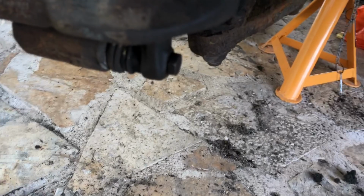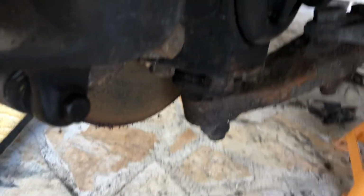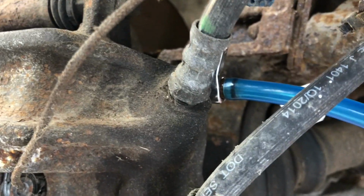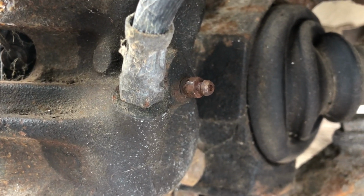So down here, the caliper retaining bolt, that one just there, is a 1/2 inch, and the bleed nipples, you can find one. There we go. That's a 5/16. Now the bottom one, a 5/16, has been rounded off. So the actual size ideally would be 9/32. Can't get a 9/32 spanner. Well, you probably can actually, but they're difficult. So I've managed to jiggle it and faff around, and we've got it to work with a 5/16. But you've got to be so gentle, because if you break one of those off, that's the end of that.